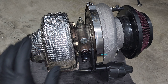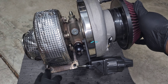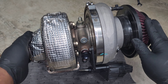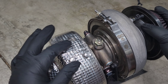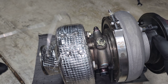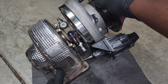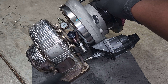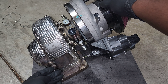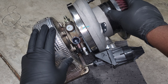Here's the final product. It's very form-fitted to the exhaust housing, rounding out all the curvatures, and it's easy to access the nuts with the thermal cover installed — that's what makes it so convenient, clean, and simple. The wires run around the little pins a couple times on each side and I still had wire left over, so it works really well. It still leaves room for the wastegate — there is a big cutout for wastegate clearance, but given how tight the space is I kind of need that anyway, and the wastegate still has enough room for full travel to work.